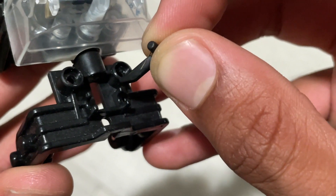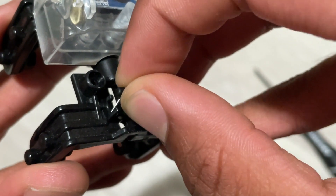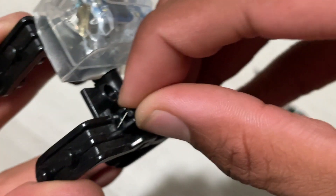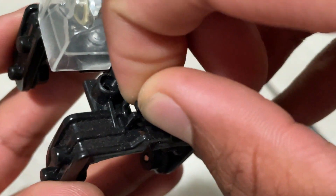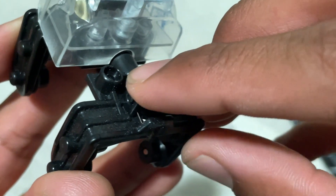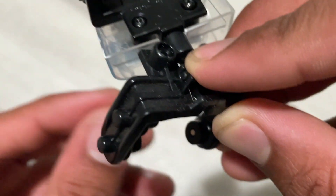Once you're getting ready to slide it into the car, you're going to take that little metal stick that's hanging out — I'm circling it for you guys — and put it in the slot. Then you want to push down. You can see the little ledge right there — push down like that. Make sure the spring goes in like this, laying flat. This is what's going to help the spring retract the dog.